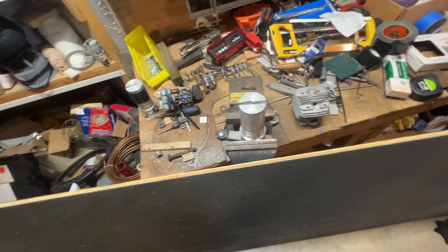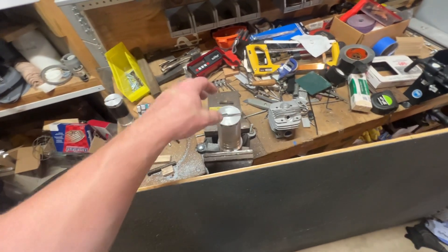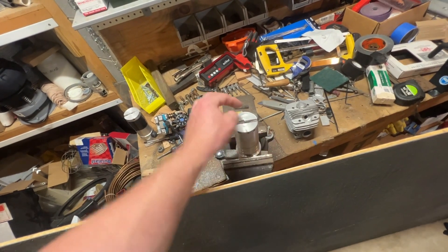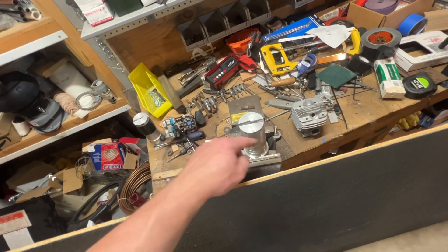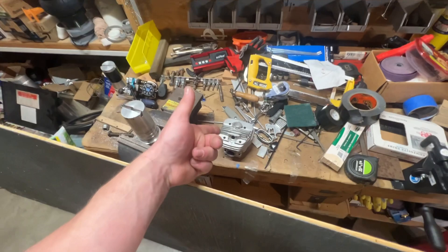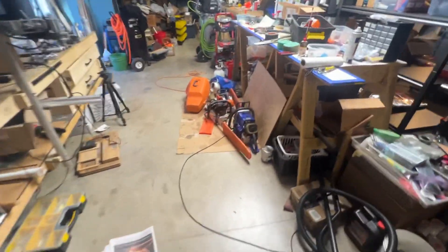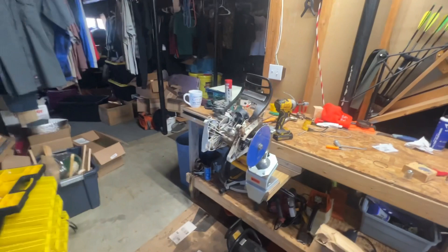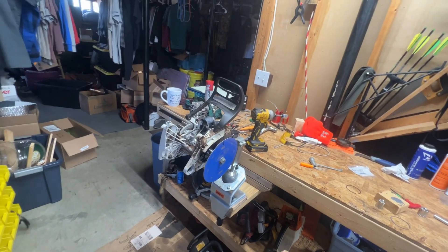This style of cutter works best with the cutting edge only on one side, and this little design I came up with seems to work pretty good. Two set screws are mandatory on this — if you have a full machine shop and can get everything perfect and true, you might not need two, but I like having two. If the holes are slightly at an angle, it'll push the cutter right or left. Two set screws let you go back and forth and lock it in the exact position you want. I'm hoping to figure something out to cut the 064 chamber so I can run that 395 piston — I can hit the exhaust port width and control intake duration by grinding a little material out of the case so the skirt can sit down in there.